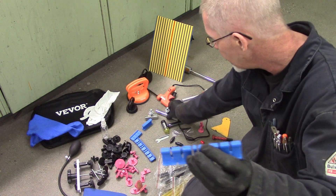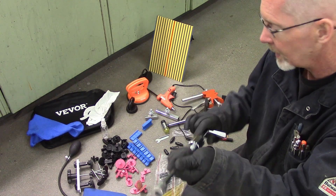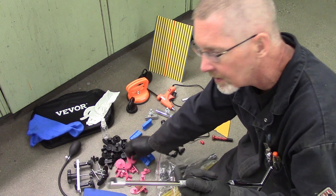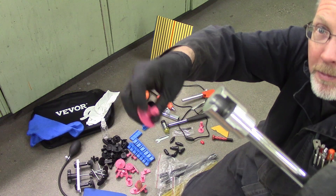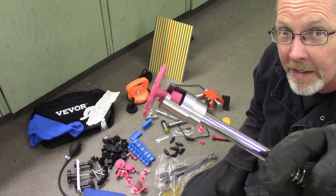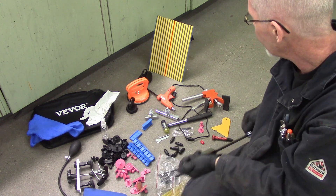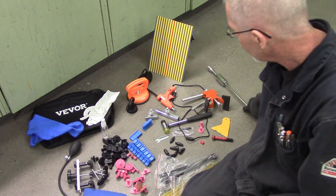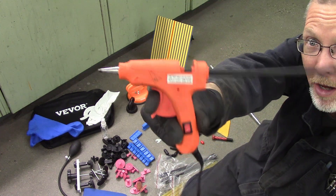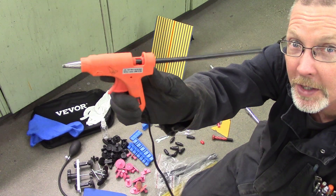The black and pink pads and the bar pads all work with slide hammers. I love slide hammers — it's got a good weight, it's got a spring on it so you don't drop it and put the dent back in, and these little hooks on the bottom just slip in. Then you bang away until the dent comes up to where you want it to be. I like hammers; I like slide hammers. The kit also comes with a hot glue gun, which is just your typical hot glue gun. Mindful when you put it down that you don't accidentally turn it off — I would probably put the switch on the back if it were me, but if you're paying attention you'll be okay.